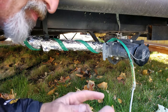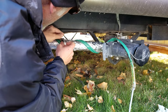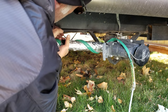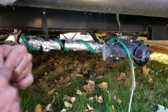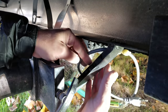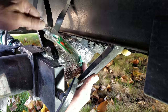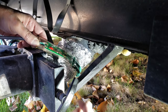We're going to take the PVC tape and anchor that in several different locations. I'm using one single three-foot length of heat cable for both the black and the gray tank valves, so I've just come over from the gray to the black line, and I'm wrapping this up so that way we're covering both. I'm going to try and leave the thermostat and the controller outside the insulation.